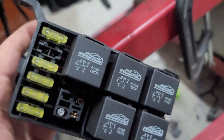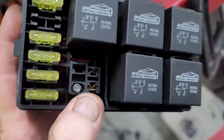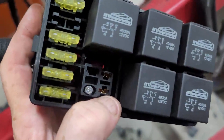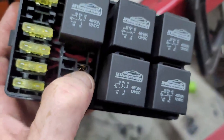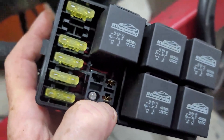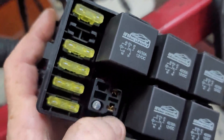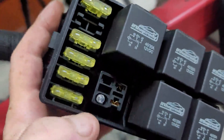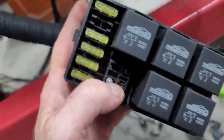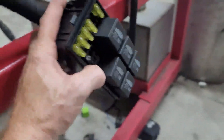Yours is a non-VVT so you're only running five of the six fuses. You've got your engine light over there in the form of an LED. You've got two terminals — the inner one is E1 (ground) and the other is TEI. If you bridge those with a wire and switch your ignition on, the LED will start flashing your OBD1 trouble codes. It's all in your welcome pack.